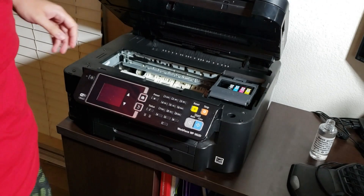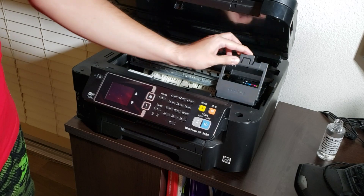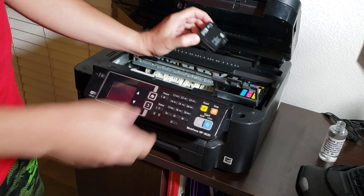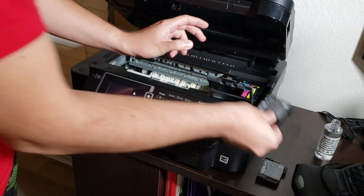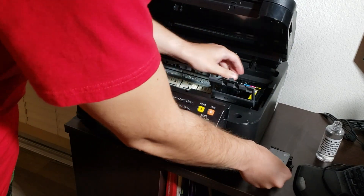As you can see, I can freely move it around. I'm going to unlock the protective cover and take out all the cartridges from the printer. If you don't perform this step, the printer head will be parked and locked to the right side of your printer and you won't be able to move it. So make sure to un-park your printer head before you do any of this.